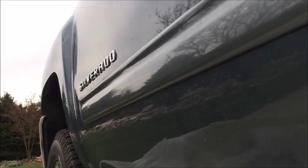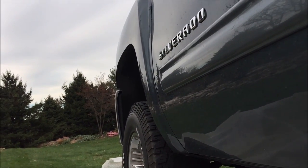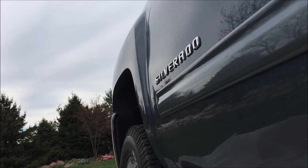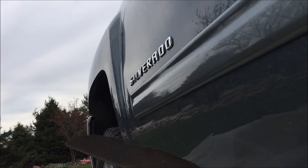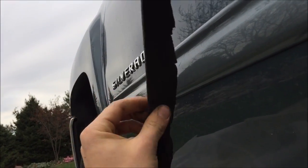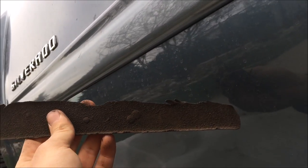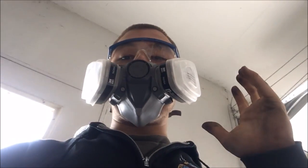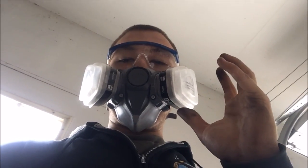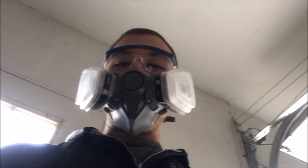This is one of the newer Silverados — you'd think you wouldn't have any problems with rust. But when you live up here in northern PA, even the newest vehicles will be facing rust. I was at the dealership in Harrisburg and brand new 2016 Silverados even had some rust on the frame. This is just a portion of the wax that they put on the frame from the factory — I was able to just peel it off on top of the spare tire. Make sure to peel off any flaking wax coating from the stock material on your frame. If you try to paint over it, it won't work well and it will just start flaking off with your paint and undercoating.